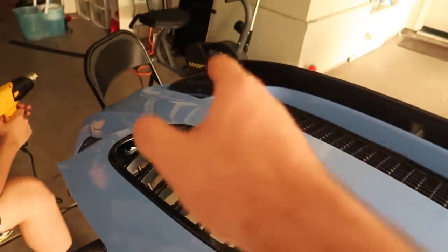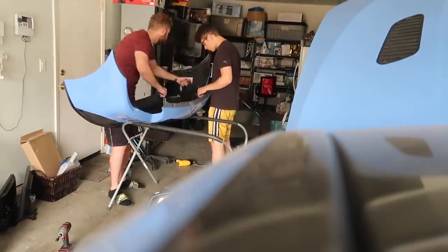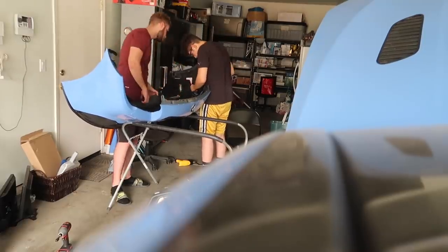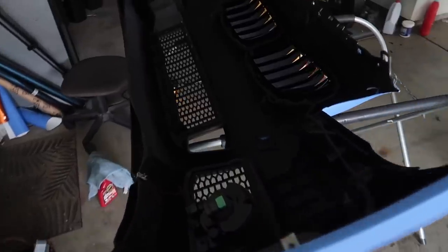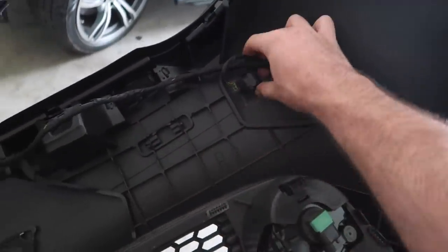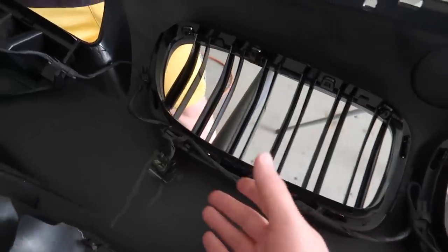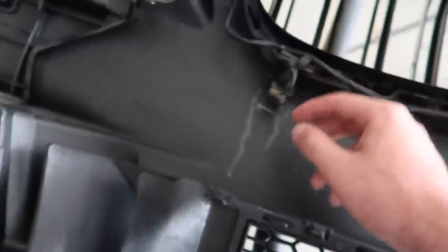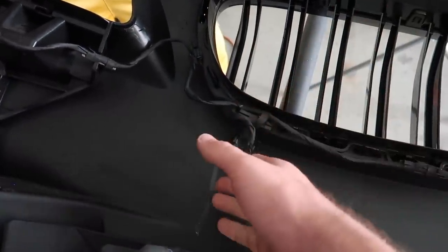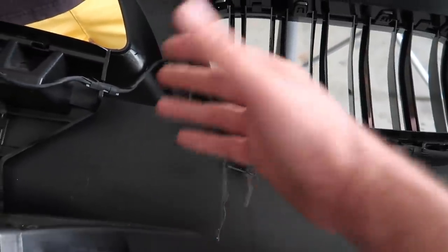As for now, we're gonna look at all the sensors and make sure they're all plugged in, because that one right there was freaking out. With the bumper completely removed, we checked the sensor — everything looks good and checks out. I know this sensor is working and that one is working as well. As for the harness, everything seems intact, nothing seems damaged. This is a clean title so I don't expect any wires to be damaged. I honestly just believe it needed to be disconnected and reconnected. I moved this sensor over here so worst case we can get to it without pulling the whole bumper again.